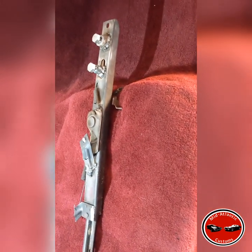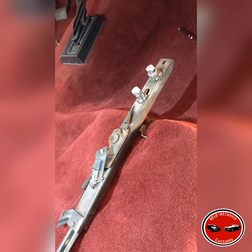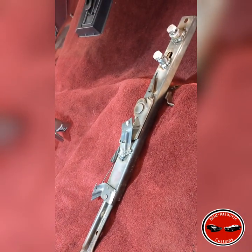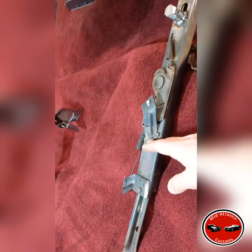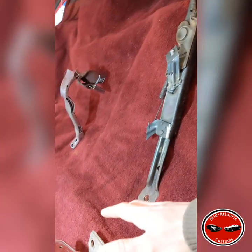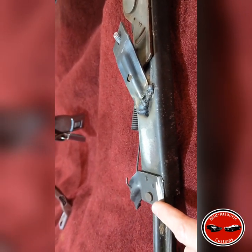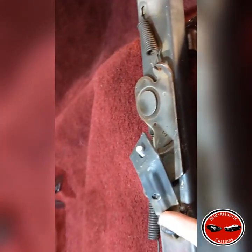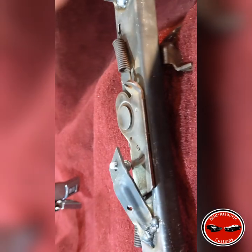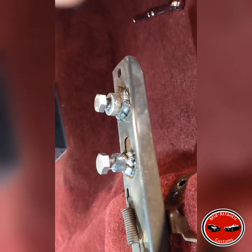I took these off and mounted them up in their stock location. Originally when I took the frame off of the Super Duty truck I bolted it up kind of centered on this frame, but what I found is the seat sat way too far back — it was actually hitting the rear of the cab. So what I ended up having to do was cut the brace off the rear of the original tracks and weld it to give me a location where I can bolt the rear of the forward seat.